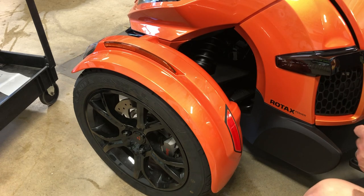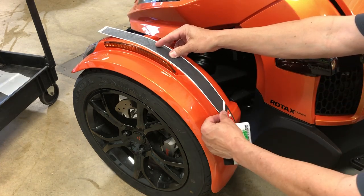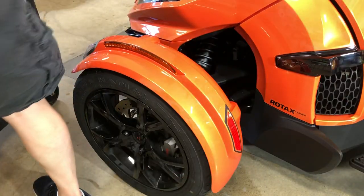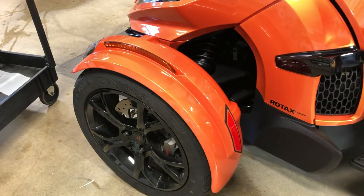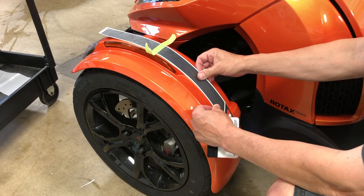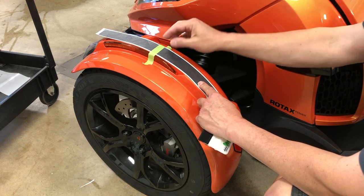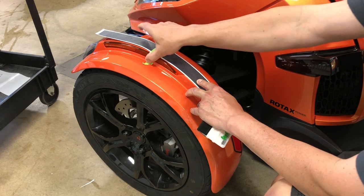For the center bar, now that you have put on your reflector piece, this helps us with alignment to know where we want this bar. So what we're going to do is I'll show you the center hinge, and then you guys can make your call as to whether you want to use a center hinge or just peel it off and freestyle the material on. Typically with a center hinge you take a piece of masking tape, run it through the center of whatever you are applying, and we're going to basically tape it into position. And that center hinge is going to hold it where we want it.